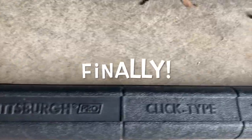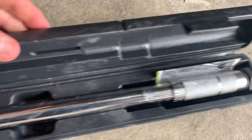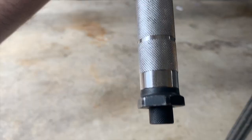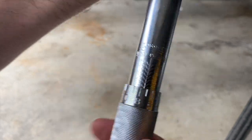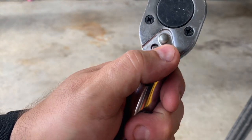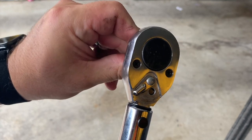Okay, I've teased you long enough — this is a torque wrench. You can get them pretty inexpensively at Harbor Freight; I think I paid $15 for this one with a coupon, and I've compared it to professional torque wrenches and it's pretty much dead on. What a torque wrench does is allow you to set it to stop and click to let you know that you've reached a certain torque specification — this is especially important on the lug nuts that hold your wheels to your axle. You set it by turning the adjustment dial at the bottom, get it to the proper torque setting, and it works just like a regular socket wrench — tightening or loosening in either direction, and it ratchets.